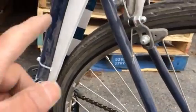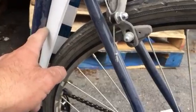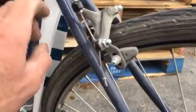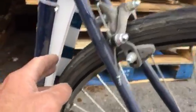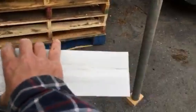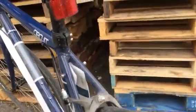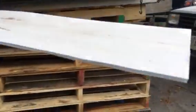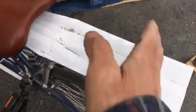For the back, same problem: water coming off the wheel hits the center beam, splashes out and hits your feet. For this V, I didn't actually need a separate piece to hold it together — I was able to jam it into the top here to create a bit of a V and then run it all the way down to the frame. It clears the wheel all the way through. Then there's the splash going on my back, so I put a little beaver tail on here — it's just a pointed piece, 16 inches long, that slides in under the seat and wedges in because it narrows at the front. It just sits there and should catch most of what's coming up off the back.